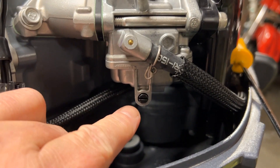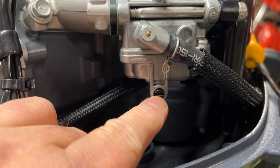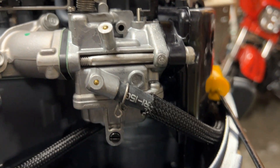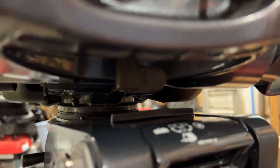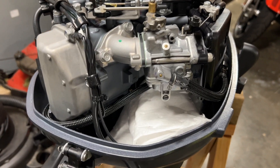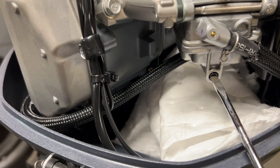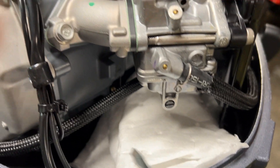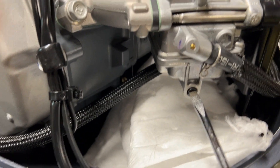One other thing — we'll need the flat blade to screw out the drain, which will allow us to drain the gas out of the carb. At the front of the motor, make sure you've got the fuel selector switch in the shut-off position. With the fuel selector switch off, the first thing I'm going to do is drain the float bowl. I've got absorbent pads designed for petroleum products ready.